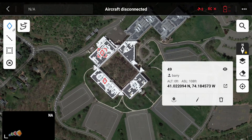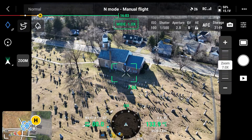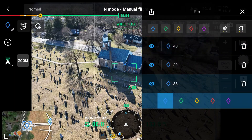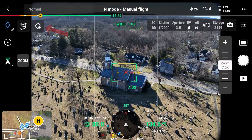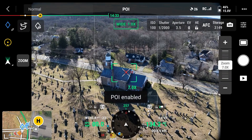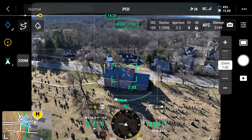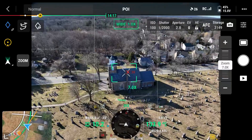Now, how to start an orbit around a pinpoint. With the drone in the air, select the pinpoint by touching it in the map view, or by pressing and holding the pin icon, selecting 'check all pins', and then touching the one that you're interested in. When you've selected a pinpoint a new icon will appear — a diamond with a little eye on it. Touch that when the drone is flying and the drone will face that pinpoint. Once it's selected, the point of interest icon will also appear — the circle with a dot and a little drone icon. Select that and POI mode will start; the drone will face the point of interest as you fly around. Doing an orbit is then as simple as moving left or right using the sticks, because the drone will keep facing the point and will keep the distance constant. That's it — you're making an orbit.